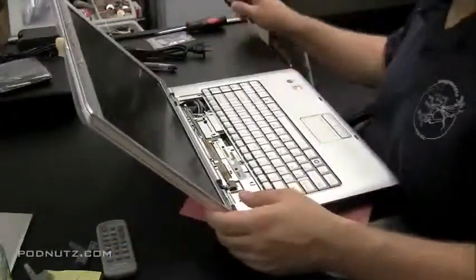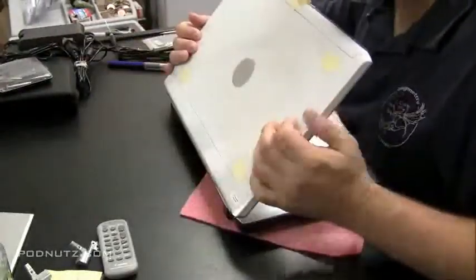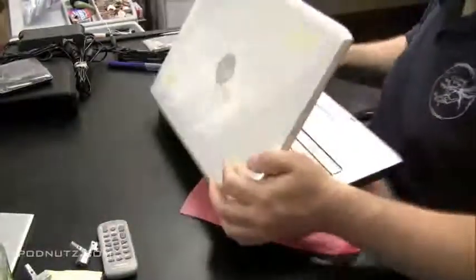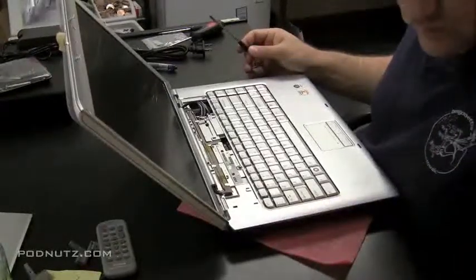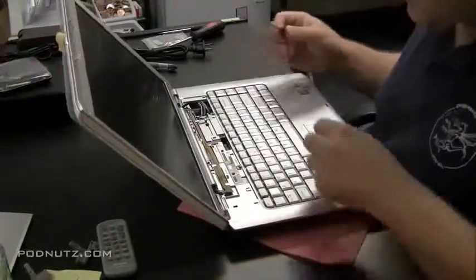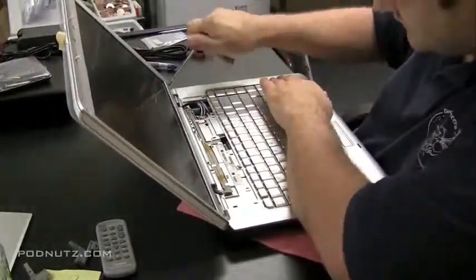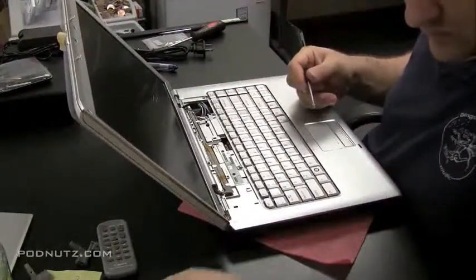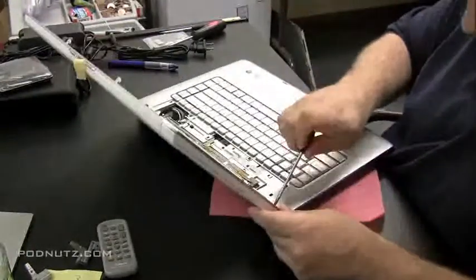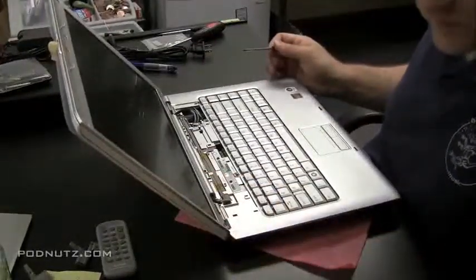And then once that's done, it's time to put the screws back in. Now remember, we're going to keep them in the same pattern as the way we took them out. So we know that that one goes in the bottom right. And the reason, again, I do that is because each screw is going to have a different amount of glue on it than the other. And because you're using those screws with the rubber pieces, you want to make sure the amount of glue is the same just to keep consistency so none of the rubber pieces come falling off.